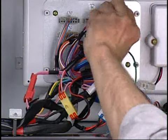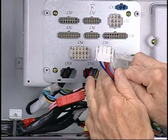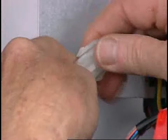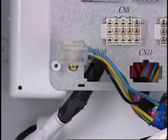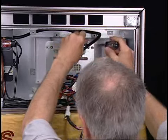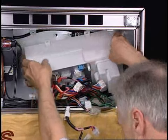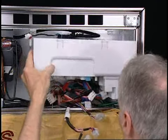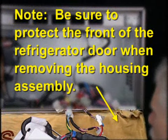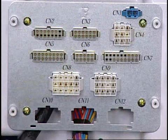Once the cover is off the board, the connectors on the terminal block must be removed. Note: the large white connectors have squeeze locks on both sides. Once the connectors are removed, disconnect the ground wires, the ice maker connector, and the main switch connector. There are two screws at the top which must be removed. With these screws removed, the plastic housing assembly — which holds the three boards and terminal block — can be removed from the compartment.